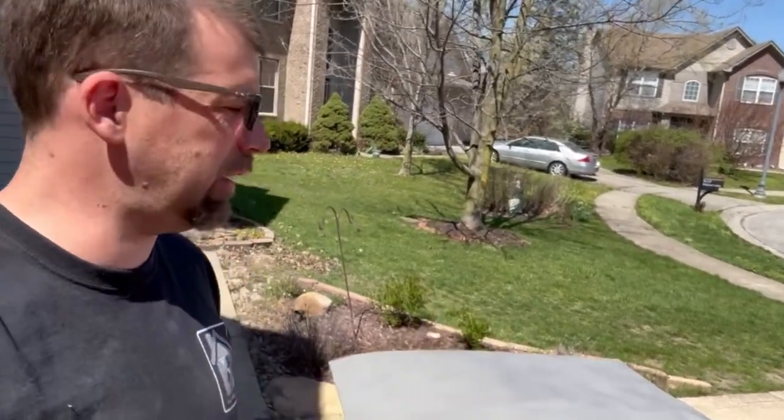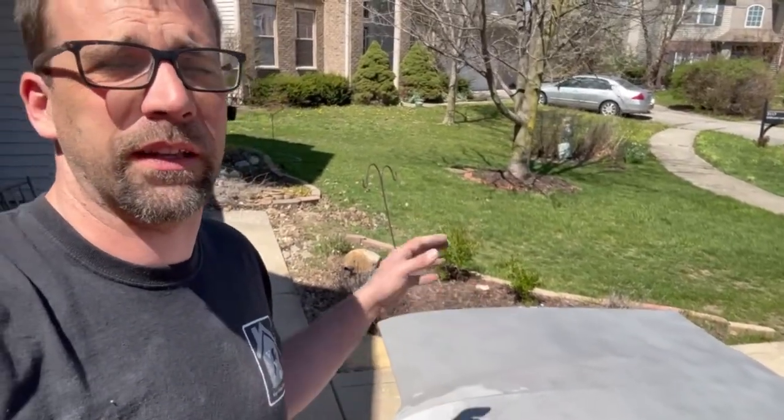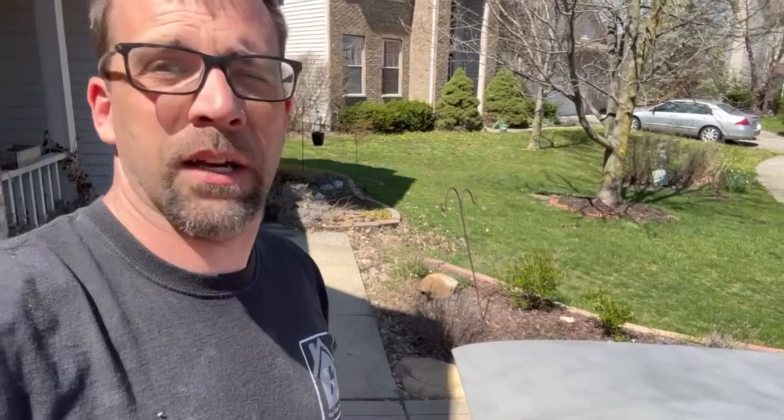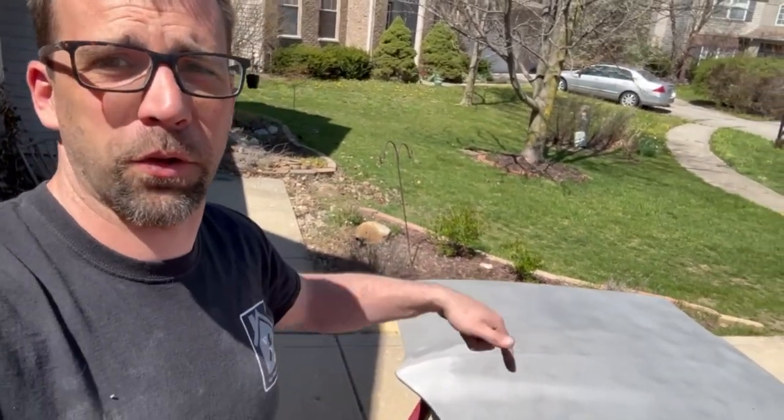Hood's on the sawhorses out here in the daylight. I'm going to paint this thing out here in the driveway because the garage is full of cars and parts right now. I'm still going to wear a mask. This is an epoxy primer I'm going to use on this. As for the prep work, I don't do anything besides blow the dust loose — this was literally just sandblasted this morning, maybe two hours ago. It's not had any time to flash rust. Some people suggest a metal wash or metal prep, but I feel it's an unnecessary step at this point.